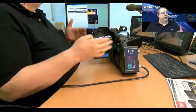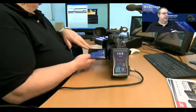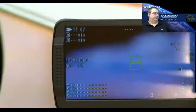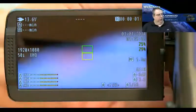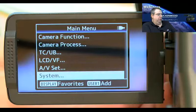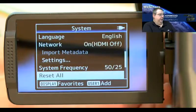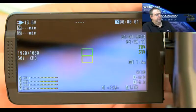I want to show you what new feature is inside the menu and where you can find and activate it after the update. First of all, after uploading the firmware, always go to the system menu, scroll completely down, and find 'Reset All.' Please perform the reset all to make sure every setting is in the correct state — this is a procedure you should always do after any firmware upload.